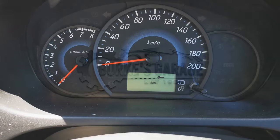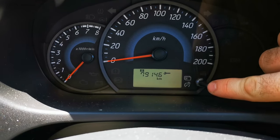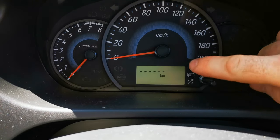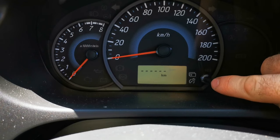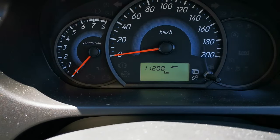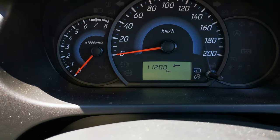Turn off the ignition and with the ignition off, scroll through this button here until you get to that section. Press and hold that button — the spanner starts flashing — then press it again. You'll see 'clear' come up on the dash, then click the ignition on and off again.